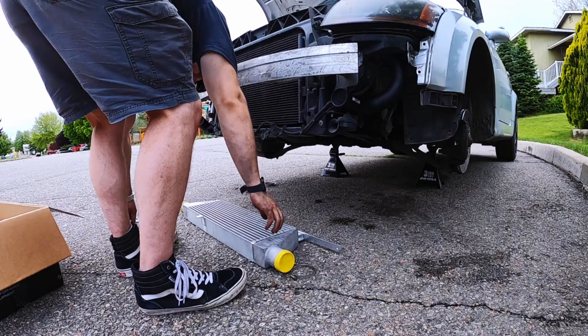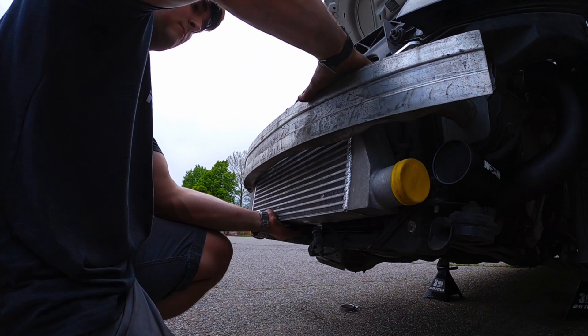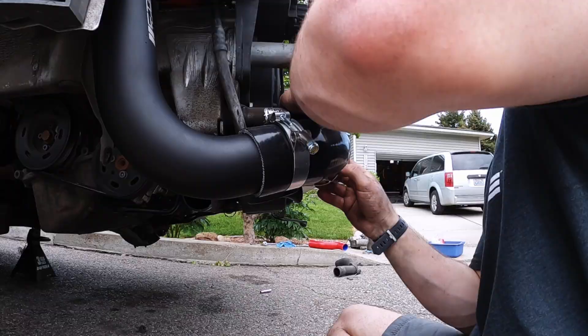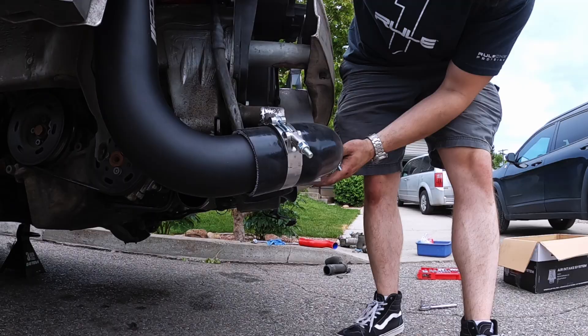Next, I wanted to test fit the intercooler — you can kind of just slide it up here. I should note I unbolted the sensor at the bottom of the radiator while putting the intercooler on. The two metal prongs on the top of the intercooler connect directly to the bolts on the top of the crash bar. These did not fit well right away, so I had to bend them a little bit to get them to fit snugly. They still don't fit perfect, but the intercooler is in there so tight it's not going anywhere. I then installed the 90-degree silicone pipes onto the intercooler so we could see what the system is going to look like when it's all done. At this time, everything is only on there loosely so that I can still adjust things before tightening them down.